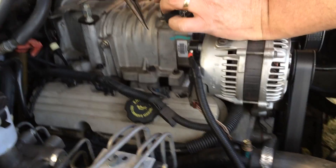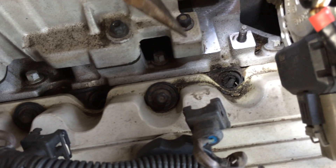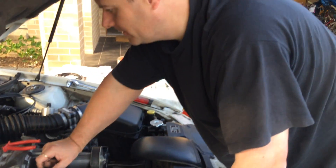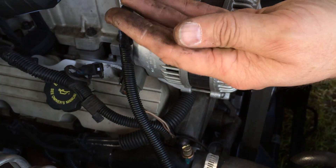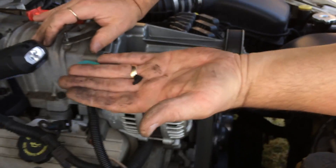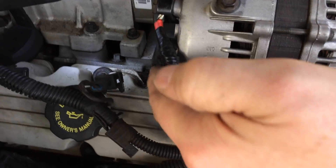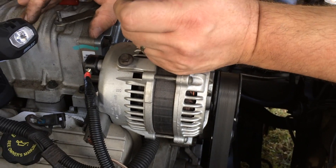We're just having a bit of a tea break and Ash noticed that one of the holes has all the crud around the outside starting to fall in. I'm going to very carefully get this out without pushing it down inside the hole. We got it out and it's this little piece of Bakelite. If you've owned a VR Commodore, VS, VN - this is the VT - the alternators on these things, this cable here gets loose and heats the cable up, and this Bakelite eventually just disintegrates and falls down there. When I took the fuel injector out, it was just falling in the hole.